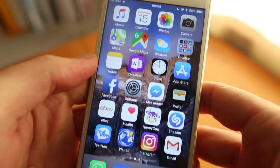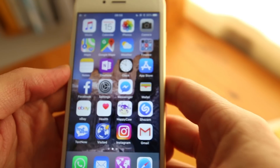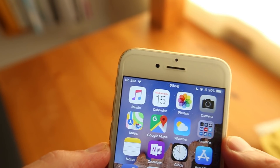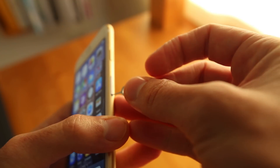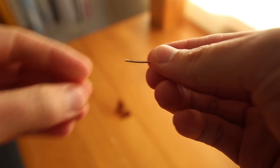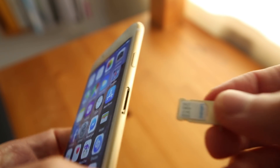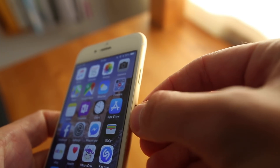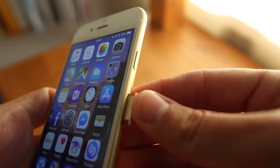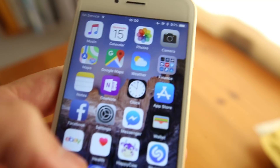Still says no SIM — even if you do the trick where you turn off airplane mode and back on, that sometimes fixes it according to some blogs, but no — still no SIM. However, I have good news. When I take this out and switch to the other reader that was already in there — bent just slightly in the center — pop in the SIM card, pop it into the slot, you do have to push it quite a bit because it is bent, really forcing down against those contacts, and then immediately we switch to no service, which means you can activate your phone.